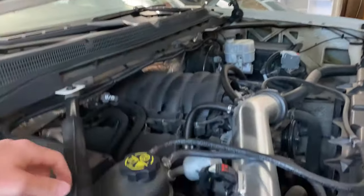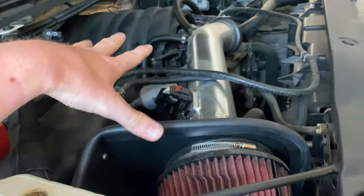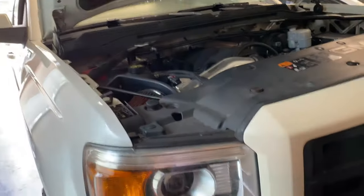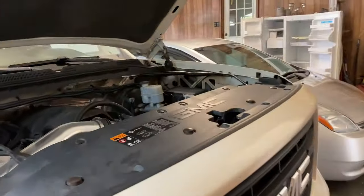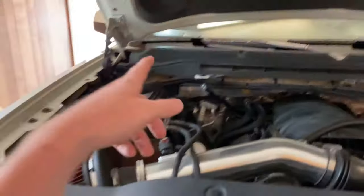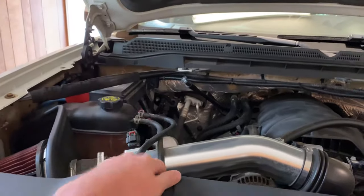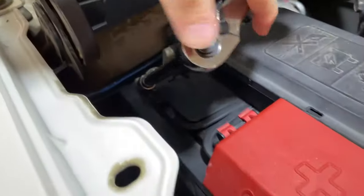We're going to fix that up there and see if that gets rid of this. The truck just flickered on me and then I was backing into the driveway and it just shut off — coasted to a stop, everything turned off. So I'm ready to do this. First things first: get that battery disconnected, and then come in here and get that front piece off. Take off these clips first to get up in there.